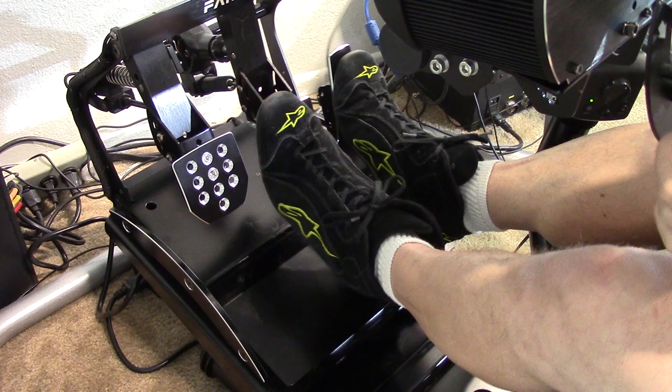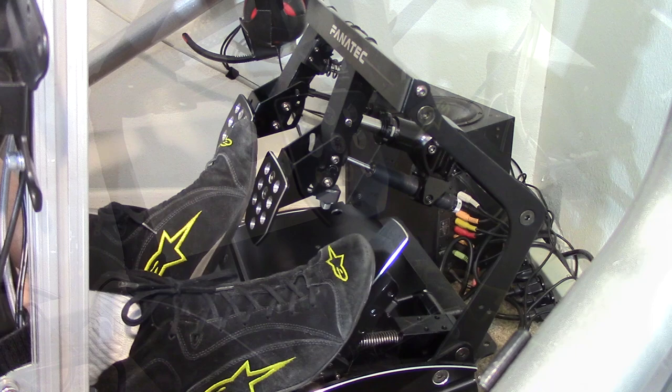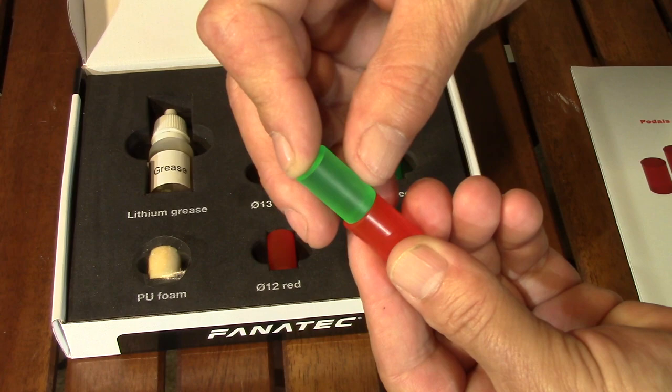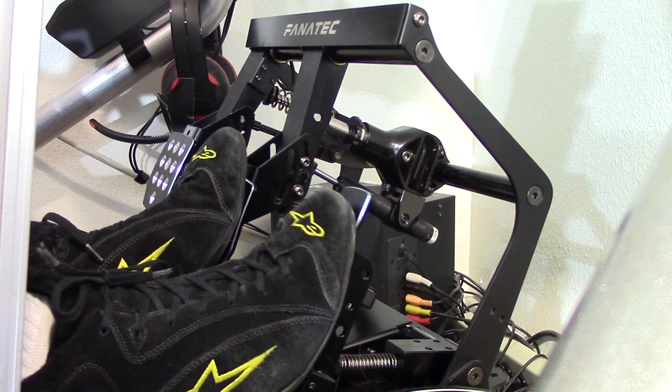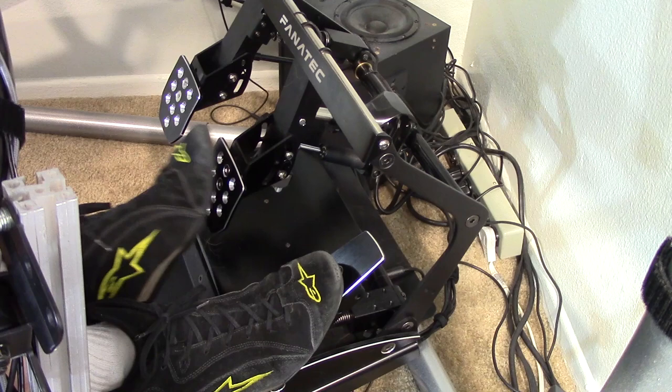I started off with the heaviest combination of bumpers to feel the biggest difference. I would say it doubled the amount of pressure required to press the brakes, limited the travel the most, and really changed the feel — it took what felt like a street car brake pedal and gave it an F1 brake overhaul. The other option, which creates a medium strength pedal, was going with a two-stage combination of hard and soft bumpers. In theory this creates a dual-rate spring with the softer spring compressing first, though the progressive part is a little hard to feel with the foot.